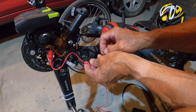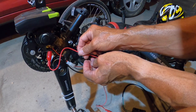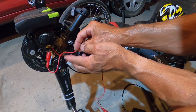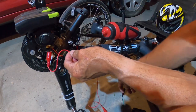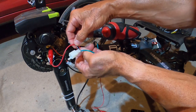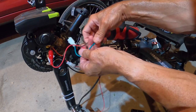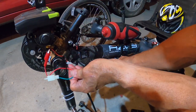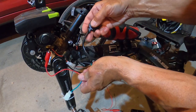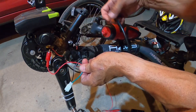For example, this red wire — underneath this tape — is cut. Where it's cut, one side attaches to the momentary switch and the other side attaches back to the battery pack. So when you push the momentary switch, it closes the circuit and you have power for your horn.